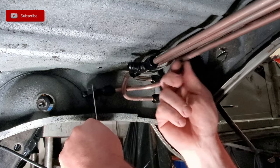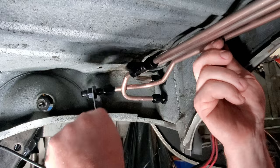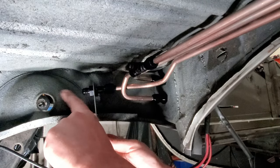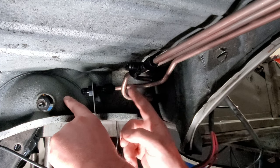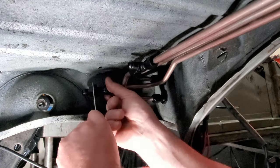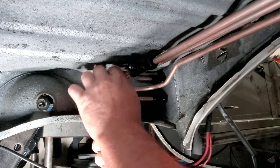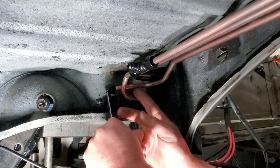You can see, once I have this in position where I want it to be, and it's going to be like that and held in place, it's awfully close to the shock top of this tower here. So I'm going to take it and cut it back some so that I can go ahead and move this back. Just anything custom like this, it's always better to give yourself a little bit more length, because I've already had to remake lines I don't know how many times.